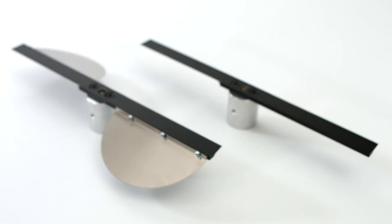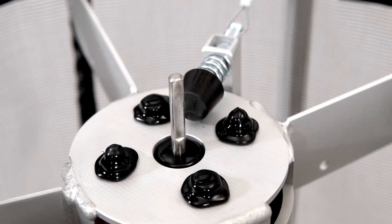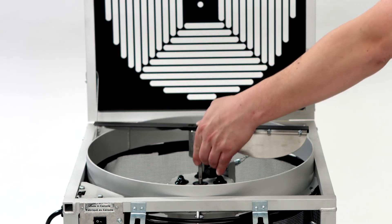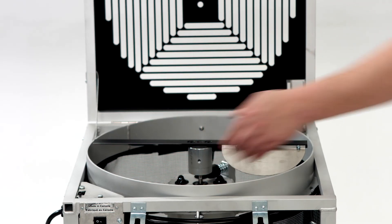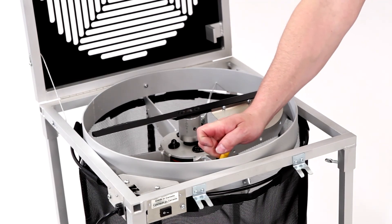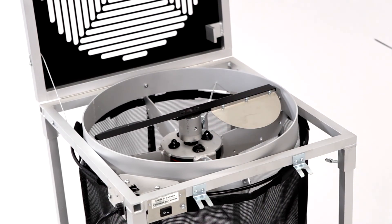You can sharpen the edges yourself with a stone, or bring it to a professional such as a garage, a lawnmower repair center, or a professional blade sharpener. Remember to align the side hole with the flat of the motor shaft when reinstalling the assembly. Make sure to press down on the top of the blade to ensure screw C is resting on the top of the motor shaft. Retighten screw B and insert screw A in place.